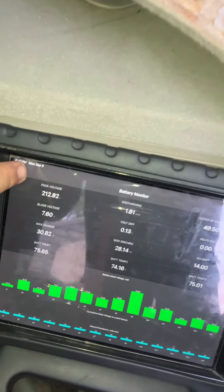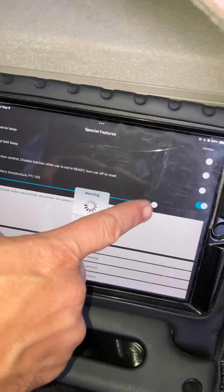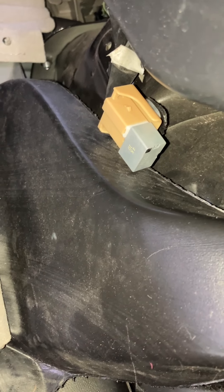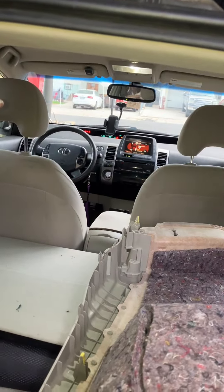So you hit special features, go to that, and then when you lower — put the camera over by that — I'm going to lower the temperature down below the threshold. You'll hear a click there, and then that's when the fan blades should go on, the fan blower. And it doesn't, and about five seconds later the dashboard light came on.